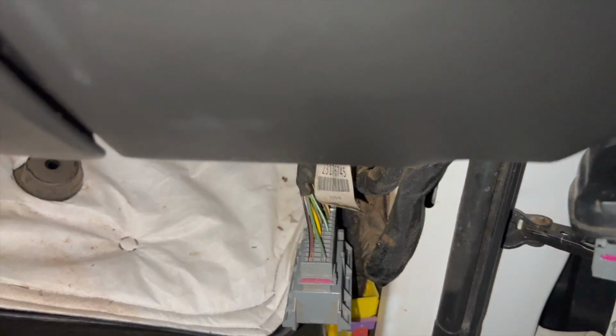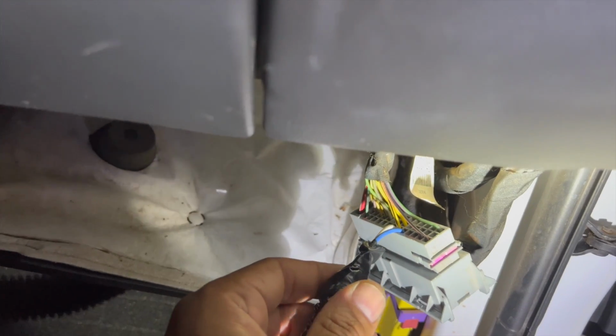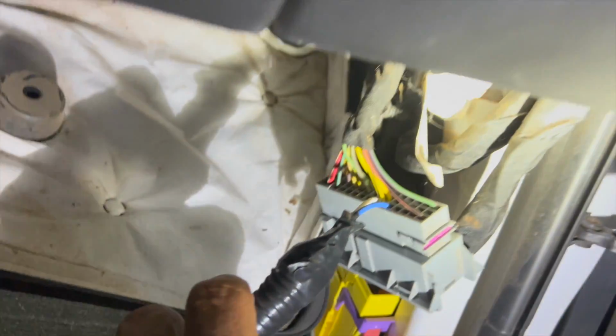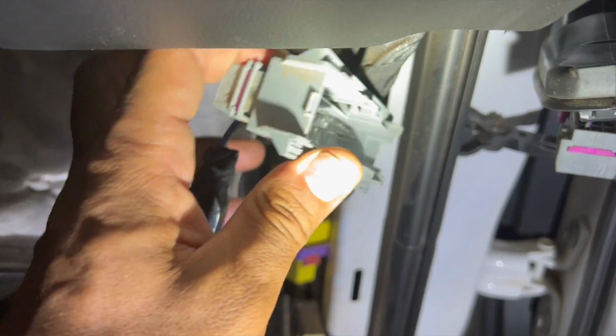And then we're going to transition to the driver's side. Hopefully they finish up soon over there. Got our wires into the door harness. Now we're going to put it back in there. Make sure that when you put it in, these hooks are facing down. Clips go to the top. Fish it in, hook it in, and then push it forward like that.